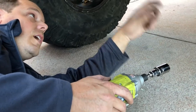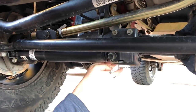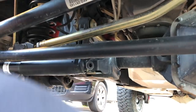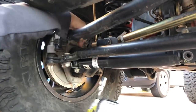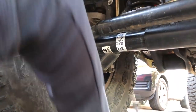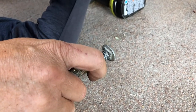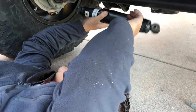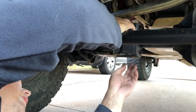Okay, so we're going to remove the steering stabilizer. 18 millimeter — pull this bolt here. There's a flag nut back here, so you want to push the flag nut forward so that keeps the bolt from going all the way through. This one is underneath, and you actually want to push down on the top of the bolt to get this off. The top of the bolt is squared — it's keyed — so if all you do is push with the drill it'll just spin and won't come off. Then you just wiggle it out and there is your stabilizer.